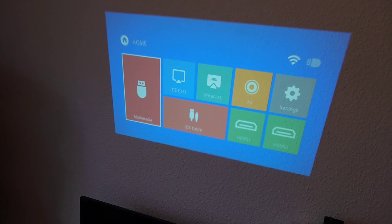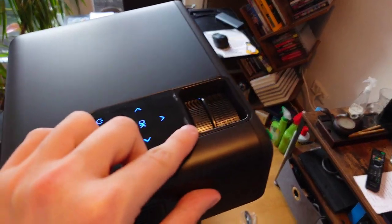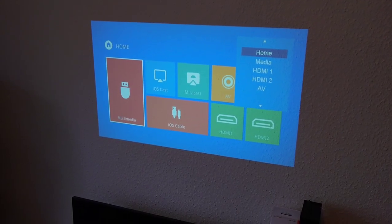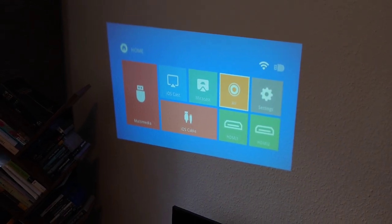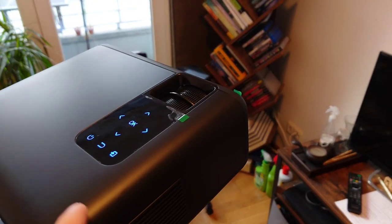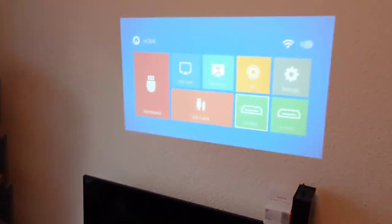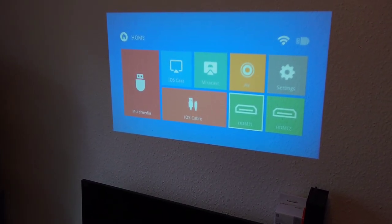The image starts unsharp, so you use the front dial to adjust focus - turning it makes the image sharper. Once focused, I noticed a slight curve, which the second dial corrects. That second dial handles the keystone correction, giving about 15 degrees of adjustment. After pressing a button we get to the main screen.